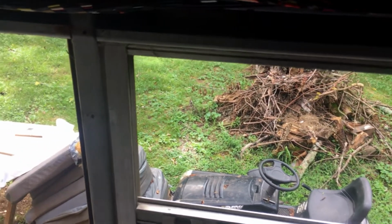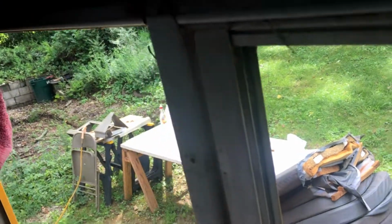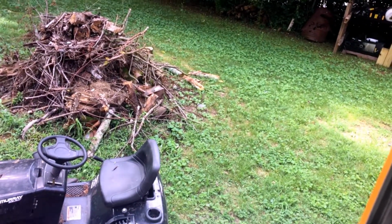You got to be real careful, because if you start beating on them at the top, you'll bend this channel, which you just have to take time to straighten back out. So what I've been doing is just using one of these blades right here and going up and getting in the corner real good, and then I'll cut along that caulk on the top and on the sides.